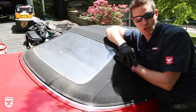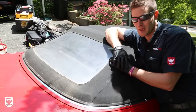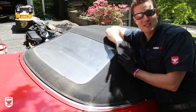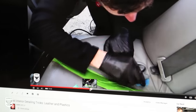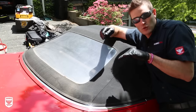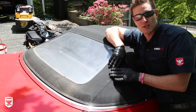Today we're working with cloth. This type of cloth material is still porous — it's sort of like your clothing, but much stronger. See all this dirt here? I wouldn't want to just go rubbing and constantly wiping it. It's the same idea as that video I shot about cleaning leather interior. There are little bits of dirt and abrasive in the edges, and if you keep rubbing, you're going to cause sandpaper-like issues with this material.